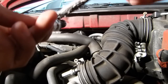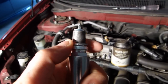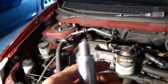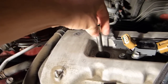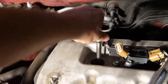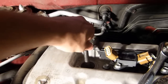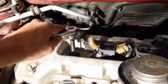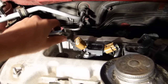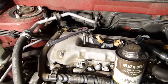I just use a tiny little bit — you don't need a lot. Put the plug into the socket, make sure it's seated inside the rubber grommet, then work it down in. Be careful not to cross-thread — it should thread in with almost no resistance. Hand-tighten until it bottoms out and seats on the engine, then tighten just a little more — about an eighth to a quarter turn. You don't want to over-tighten or it'll break. There's probably a proper torque spec, but I've always done it this way and they've been fine.